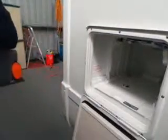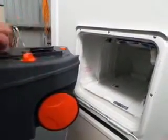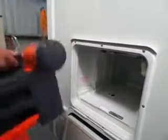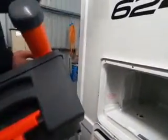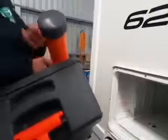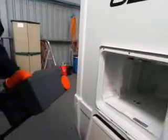I'll just splash it there. So you can look through there to clean it out if you want to. You can clean it out by just putting water in that end and then just sloshing it about. But don't thrash it about, because there's a little float in there that's attached to a sensor on the flush tank on your system, your toilet. If you thrash it around too much, that drops off and it'll go down the emptying point. So don't thrash it around too much, because you could end up losing it.